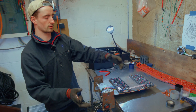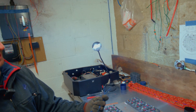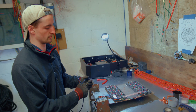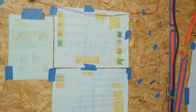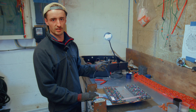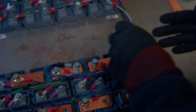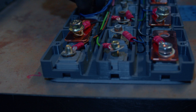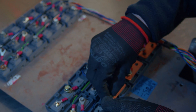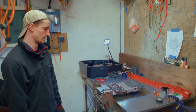And that's kind of how we attach each box in series with each other. There are a few other bits from the Leaf that we reuse. So this is a temperature sensor — each of the battery boxes has three of those, which is quite convenient because we put one in each of our three battery boxes. That just feeds back the rough temperature of the battery box to the Leaf BMS and means that we can just check that everything's running at a safe temperature. I've put this one in this box already, just roughly in the middle of the pack. And that feeds straight out the same plug as all of the cell taps here. The cell taps in each box basically just measure the voltage of every single cell we have in that box, and then the BMS for the car can measure those and manage those to make sure that all the Leaf cells when they're being charged and discharged stay somewhat balanced and keeps everything running smoothly.